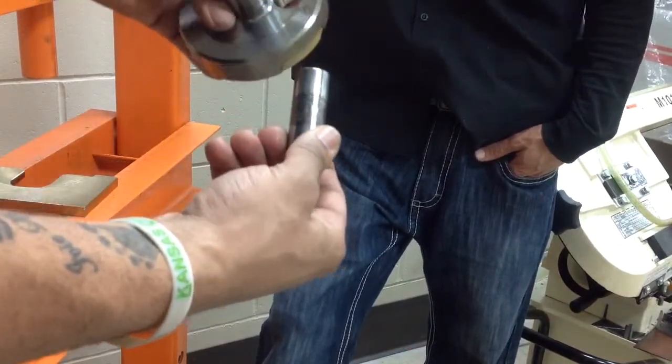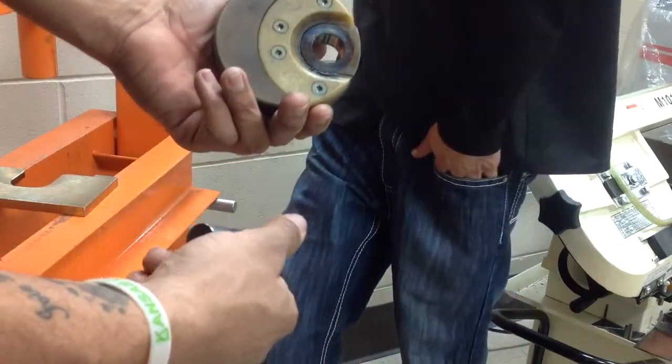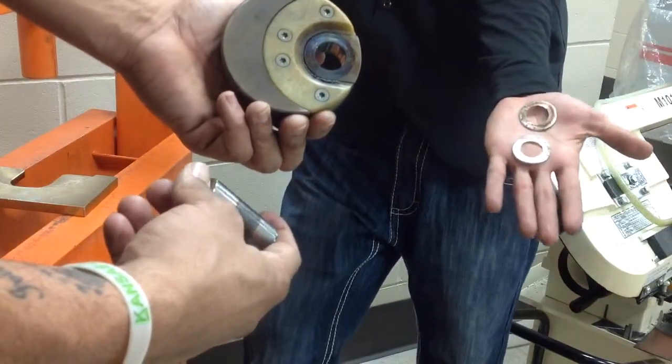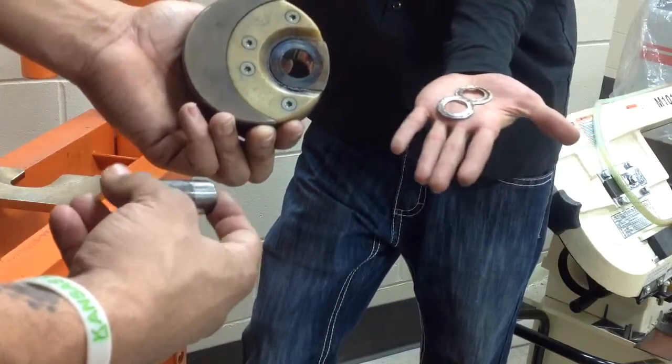Flip it to the inside of the crankshaft. You can notice a lot of heat got built up in there. We'll closely inspect that crank web to make sure that the machine surface is going to be doable for the thrust washers. Lionel's showing you the thrust washers — they were extremely worn as well.